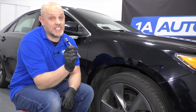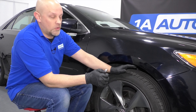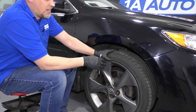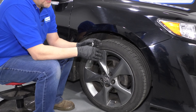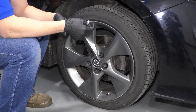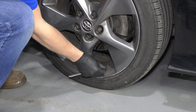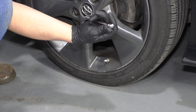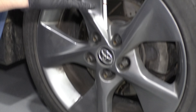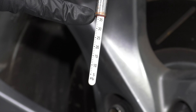It's always a good idea to have a tire gauge in your glove box so you can check your tires on a regular basis. You want to make sure the tires have cooled down when you go to check them — you don't want to have just gotten off the highway. If the tires are heated up, that's going to cause the pressure to read higher and it won't be an accurate reading. What you can do is take the cap off, find the valve stem, take the tire gauge, press it on, seal it, and check the tire pressure.